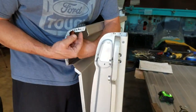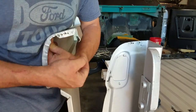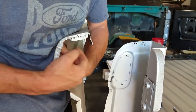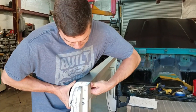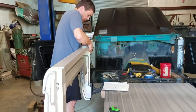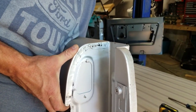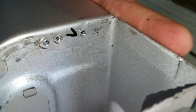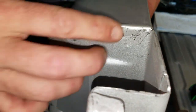I had to take my saw because they make these joints so tight you can't slide this between it. You just take a 3/16 blade and run right up the edge of that. This steel falls in behind here. Now this is noisy, sorry. You want this fit to be really tight. And the tighter you get with your saw blade right in here, the more flush a look you'll have right across your edge here. That takes a lot of finesse to get it just right.